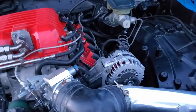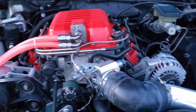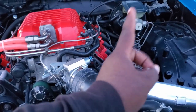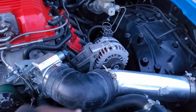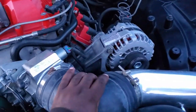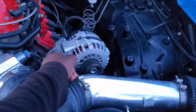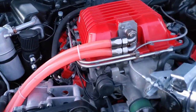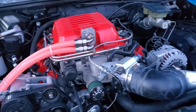We have a Holley bracket on this side - the original bracket I had when I originally did the swap about five years ago. I removed the spacer it comes with and it aligns perfectly. For the intake pipe, I'm going back to that performance shop - they're going to custom make me an intake pipe. For now it's just a rubber boot intake pipe I had laying around. I had to relocate the power steering here because it typically mounts right above on those brackets. And yes, clear hoses on the coolant lines - I was the first to put these on an old school G-body.